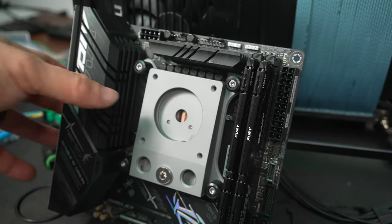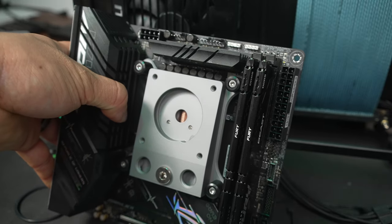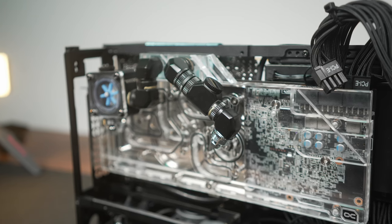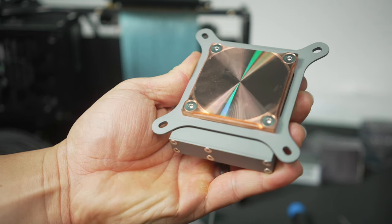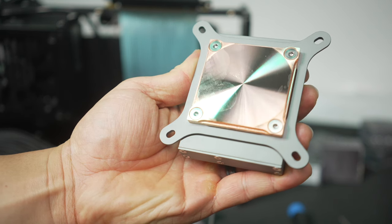Decision number one is going to be your pump. Sub 10 liters, you're usually going to have to go with an external unit or a CPU pump block combo. In the T1, unless you're using a really short GPU block and you can overlap your pump res with that block, there's not a reasonable location to mount a standalone pump res. So those two options are your only options here. There's a provision for an external pump at the back — you can use a bulkhead fitting at the back of the case with an Iceman DDC or something like that. For this build, a company called Mod Ultra sent over a pump block for us to check out — big thanks to them.